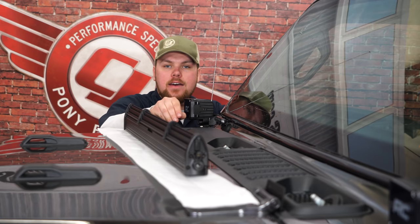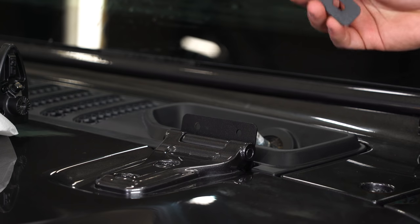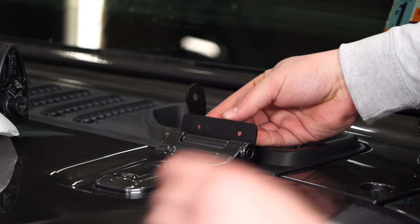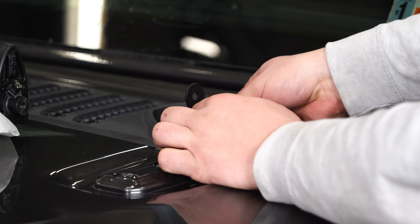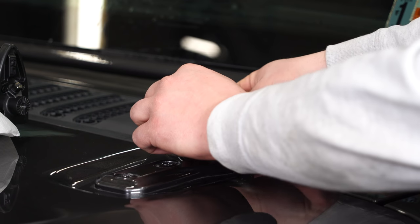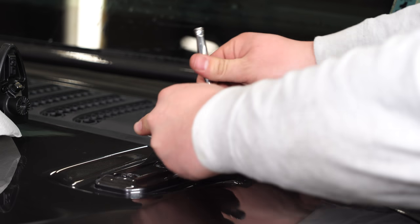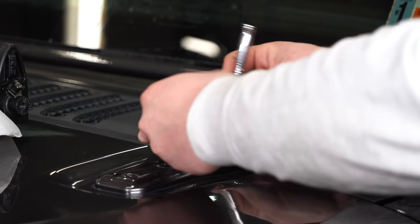Once all the push pins are back into place, we can now work on the driver's side, getting the second half of the bracket installed. With the cowl properly installed, this is what's actually going to hold the light bar on — it slides behind here. Then we're going to use the included 4mm allen head bolt to go through the front, put a washer on the back, and then your nylon lock nut. I'm going to get these snugged up with a 4mm socket and a 10mm socket — just to get them started, these are adjustable. I'll get the other side mounted and get the light bar on, then we can make our final adjustments.